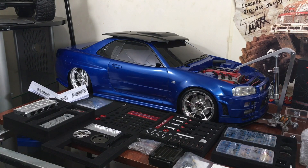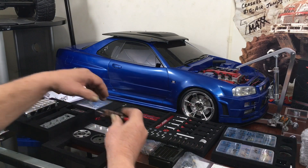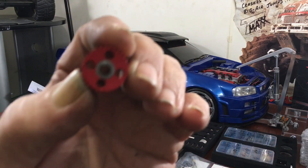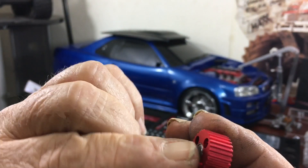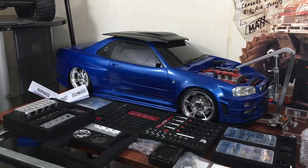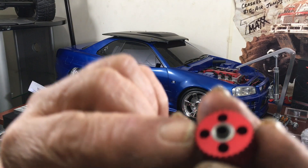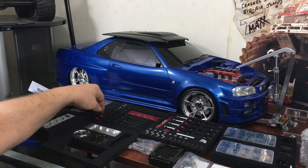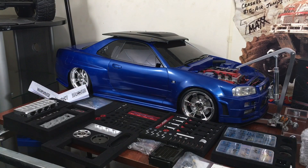Another important thing: on the cam pulleys — this has already been assembled for you with the bearings in it — put some oil in that bearing and turn it. Mine was squealing like crazy after I got it in the car and I couldn't figure out where it was coming from. The bearing just didn't have enough grease in it. I use HHS 2000 from WD-40 — it's a sprayable lubricant that goes on super thin.